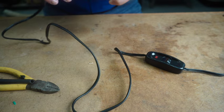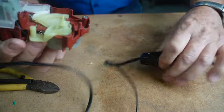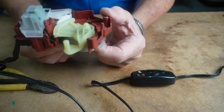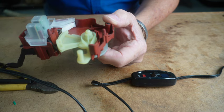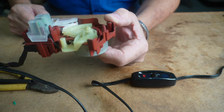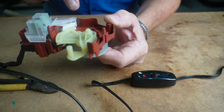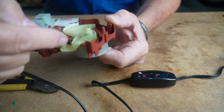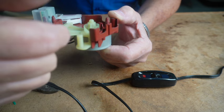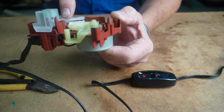Plug it in. And let's see what happens. Okay, you can see our little motor is working the actuator. And the way this works in the real world, when this is hooked to the washing machine, this little pin on the actuator interfaces with the splutch and it shifts your washing machine from agitate to the spin mode. And there's a switch right here